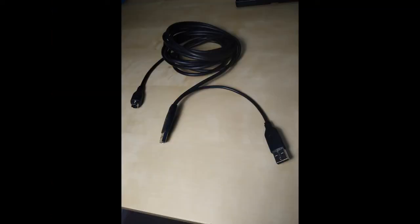Anyway, the design features a quick connect — looks like an old PS2, or very similar to me — about 2-3 inches away from the keyboard. And then you've got 10 feet of cord or so that goes to your computer and plugs in with a dual USB, just like this. The issue seems to be when he's moving the cord, it'll disconnect. I'm thinking that the connector is the problem, but I don't know on which side.